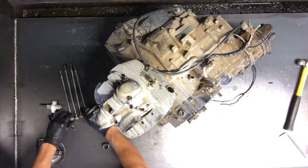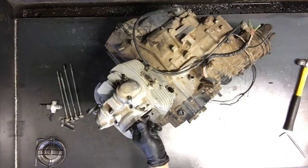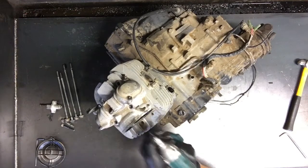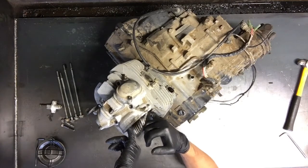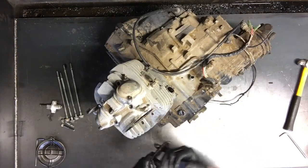So two different sizes of the head bolts. I'll pull the cam chain sprocket off — use a 17mm socket to do that. You want to make sure that you pull that tensioner out before you do that or there's going to be a lot of pressure on the sprocket. Now, since we're pulling the whole crank case apart, we'll actually just let that cam chain drop down into the motor.